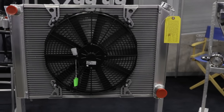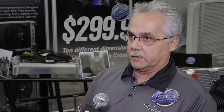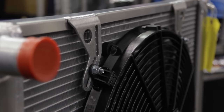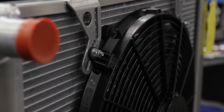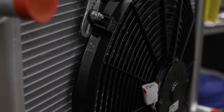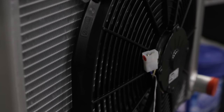How many different part numbers do you cover with that series? We've got ten different part numbers — eight crossflows in different sizes and two downflows in two different sizes. And it's set up with everything you need to use it in an LS application? Right. Right size upper inlet, right size lower outlet. On the crossflows, they're dual pass radiators, and a lot of people ask us what a dual pass radiator is and why it works. The water passes through the radiator core two times instead of one, which helps cooling.